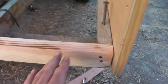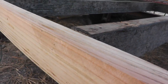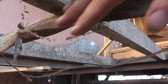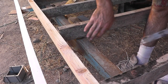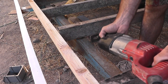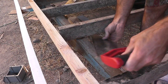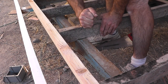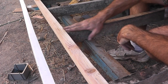I've got this outer floor support attached at both sides of the trailer, but when I started to attach it to these inner joists, I noticed that this middle board was raised about an eighth of an inch. Upon some investigation, I found the culprit — a bent frame under here. Looks like somebody ran over a fire hydrant. Instead of trying to bend this frame back straight, I'll trim a little bit off the bottom of this board with my sawzall. It turns out my sawzall won't fit in here because of another joist getting in the way, so instead I'll use the trusty old handsaw.